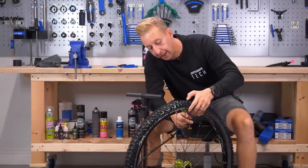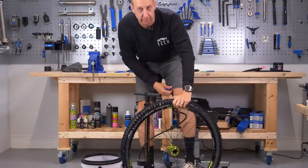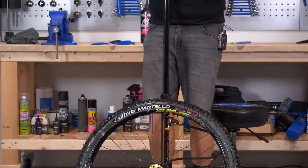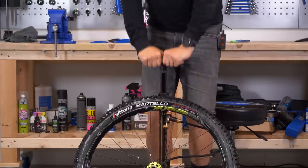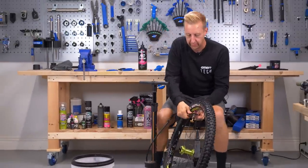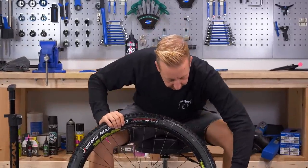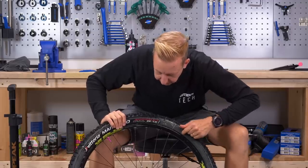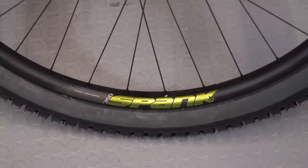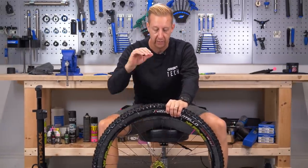Don't forget, you want to get this seated. You may need a tubeless-specific pump, but I'm going to get away with a regular pump here because this is quite a tight fit. If yours is a bit looser, it might be to your advantage to have one of those specific tubeless pumps. You should hear the beads snap into place. As with seating any tire, you want to make sure you go all the way around and inspect it. There's a black rim that runs around the edge of the actual rim between the gray sidewall and the bead of rubber, so you can visually see that the bead is in place — same for both sides.